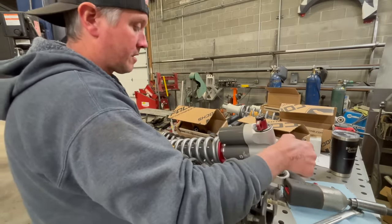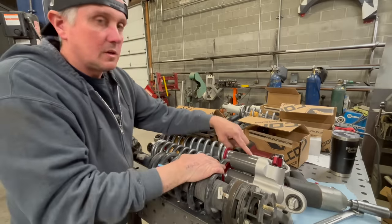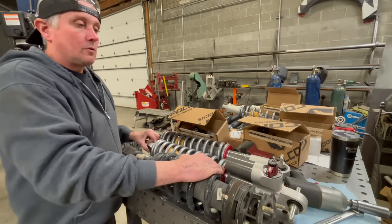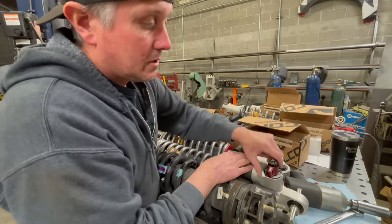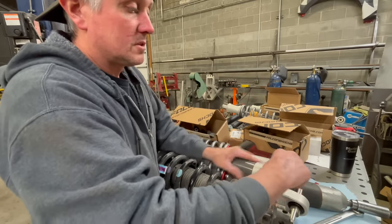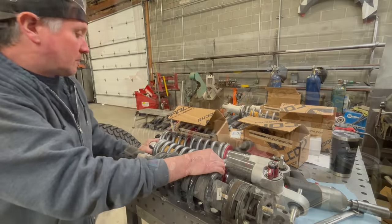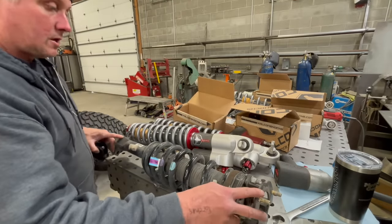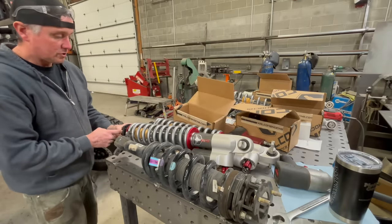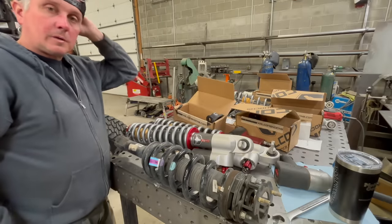The Falcon's body itself is larger, so it holds more oil, and it also has a reservoir on the end that holds an even larger amount of oil. In that reservoir it also has adjustability for compression — three settings: one is soft, two is medium, three is firm. But if you go to the number two setting, you also have a second dial with eight fine-tuned settings inside of that. It also has bump stop built into it and a coil over it. The other thing I was worried about — this shock is shorter than the stock one, but it comes with upper caps that push the upper shock eyelet through the shock tower about an inch. So I think we're going to be fine. Probably have to struggle a little bit getting them in, but that's kind of normal.